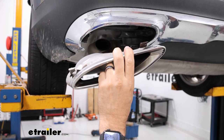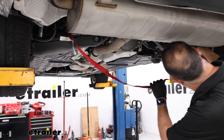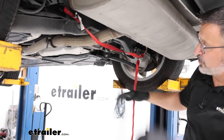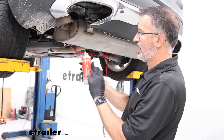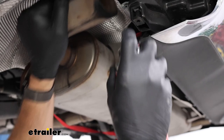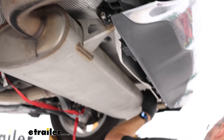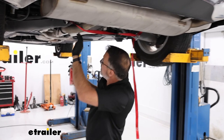I have a cam buckle tie-down strap and we can hang it up on the coil springs on the rear, because we don't want the exhaust to hang on its own — it could damage it. If you are on your driveway with the back end up on some ramps or something like that, you can just get a block of wood or whatever you need to support the exhaust so it's not hanging on its own. On either side we're going to have a total of three rubber isolators that we need to get loose. I have silicone spray — you can use soapy water too — but the key is to get the lubricant inside because it's going to make a big difference. You'll have one on the driver's side, another one on the passenger side, and then if you follow the exhaust down you'll have one more at the rear axle.